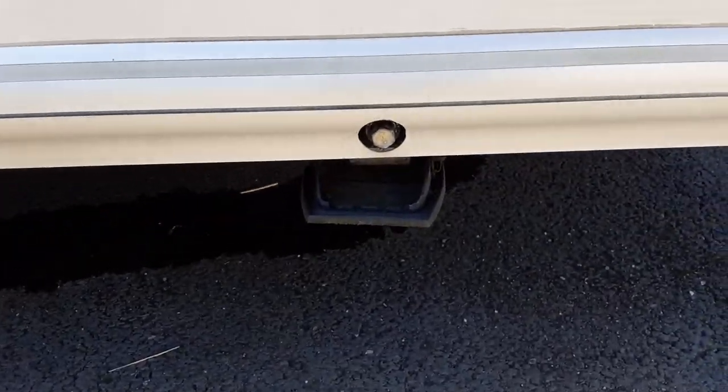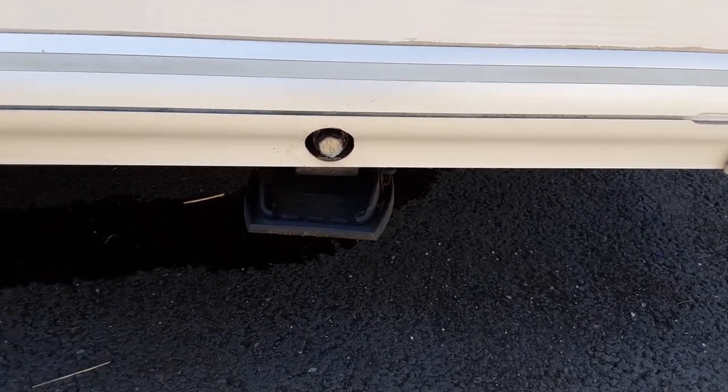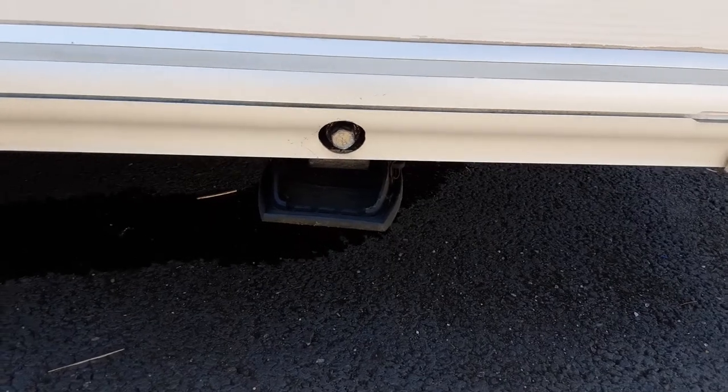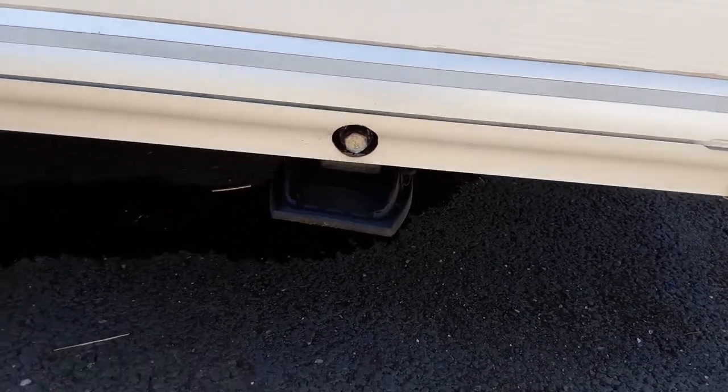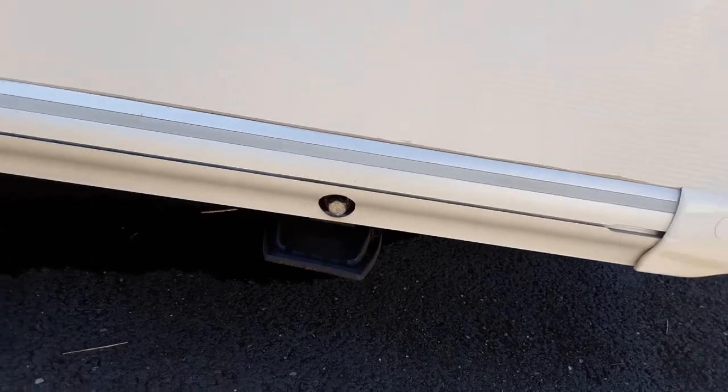You've got your wind-down leg on this side of the van which is there for stabilising the caravan. You'd never use it for lifting the caravan — you just stabilise the van with that. Put a slight amount of pressure on them as they go down on the floor, but you wouldn't lift the van any further than that.